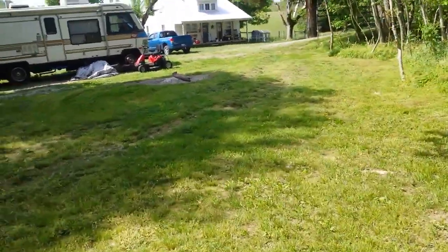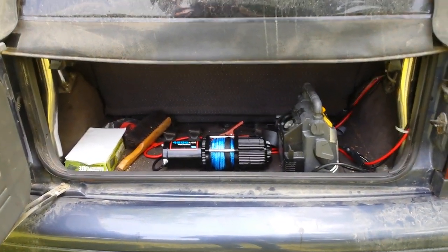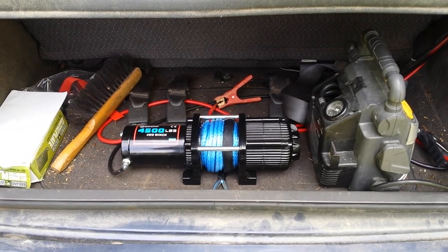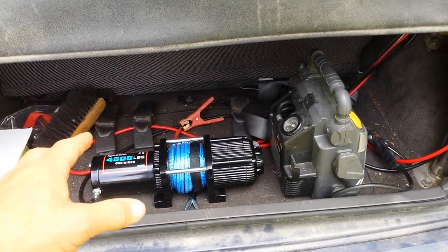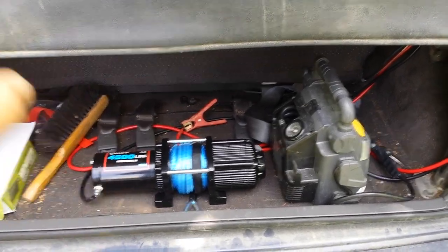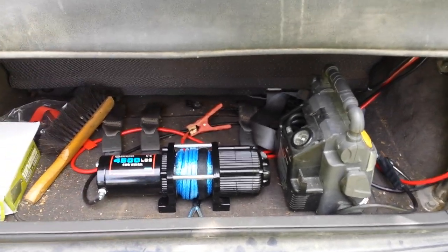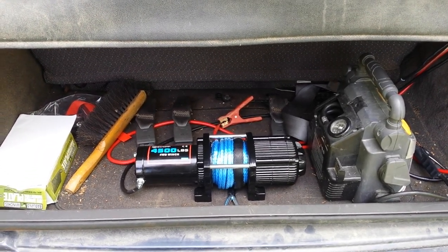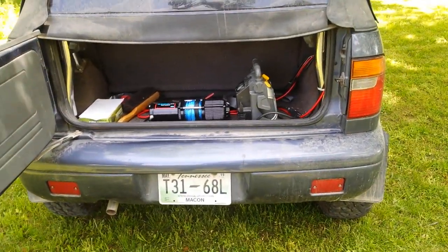That's only half of the winch install — the second half isn't done yet. The second half is going to be a rear-facing winch. That little fella is also a 4,500-pound winch. I took a gamble off eBay and paid $50 less for this one than I did for the front winch, but all the specifications were exactly the same — both rated at a two-horsepower motor, both came with synthetic wire rope, both have the standard drum lock, and both have a 136-to-1 gear ratio with three-stage planetary gearing. The reason I want a rear-facing winch is because I tend to get into trouble in tight little spots.